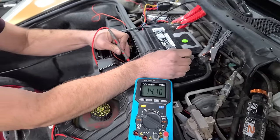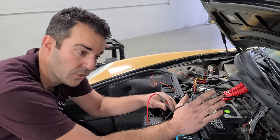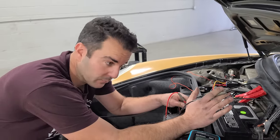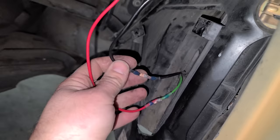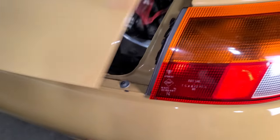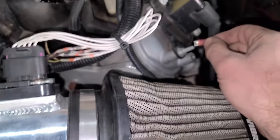So that is a problem because at that point they're relying on that temperature sensor back there to turn the fans off. And sometimes when the temperature sensor completes the circuit to turn the fans on, it can take a really long time for it to break that threshold on the way down to turn them off. It probably killed the battery. But either way, we have taken over that system. So now we're running right to the factory fans and these guys are eliminated. And now if we take this wire that plugs into that sensor right there and just go right to ground.